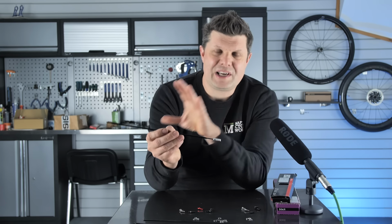Now, if you're going outside one of the major brands and the brand that you're buying from is a hookless design and they don't have a tyre pressure calculator or recommended pressures, you really need to pay attention to the details. So brands that fall into this category, we've talked about them before, Extra Light, Percenti, etc. And here on the Extra Light product information, you can see there's very specific details about how many wraps of rim tape you have to use, the thickness of the rim tape that you have to use, and even add in additional layers to absolutely fine tune the fit to make it safe. And then there's very specific pressure guidance as well. So you still have to go to your tyre manufacturer, check their pressure and recommendations, your body weight, and still do a lot of checking to make sure you've got a safe setup.